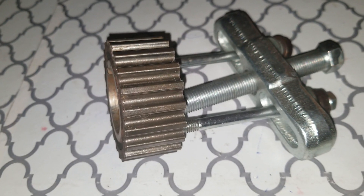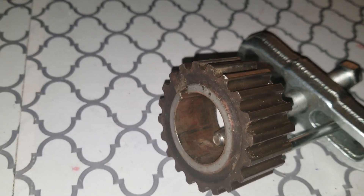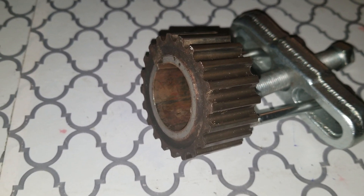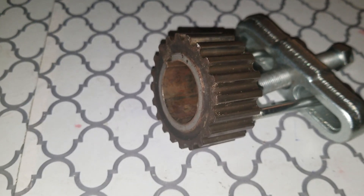That rust was the reason why I couldn't get it off. I wanted to make this video also to say — and I've been talking to some other mechanic friends — you definitely do not want to heat the crank up to pull this timing belt gear off a VG 3.3 liter engine. This is on a Nissan Xterra 2001. You will definitely warp the crank and can end up with a rod knock because it changes the shape of the crank.